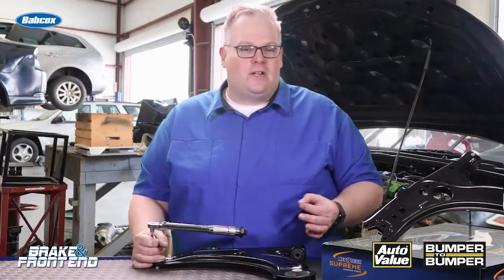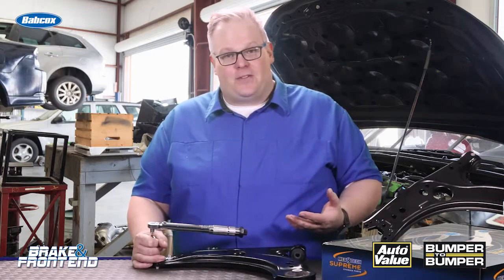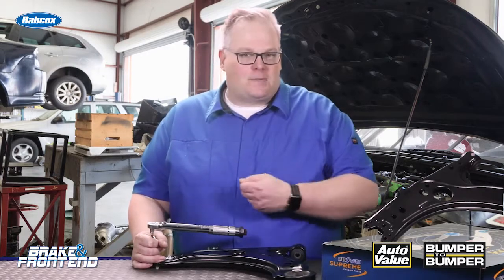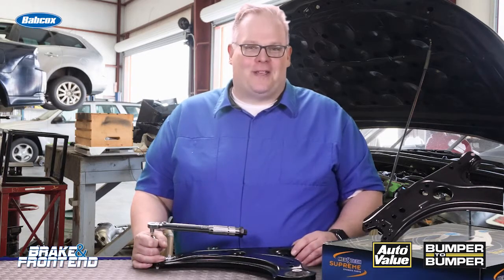This is a sign that it's brand new — the cup and bearing are within specifications. It's actually normal for this ball joint to feel stiff before it gets installed on the vehicle. But once you install it, move the knuckle around to see if there's any memory steer or hard spots to see if it was installed properly. I'm Andrew Markell. Thank you very much.